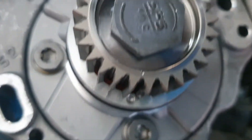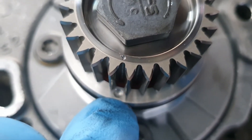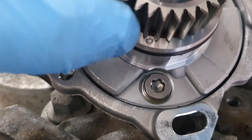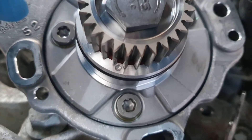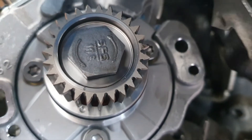What we have here is a brand new fuel pump. You can see we've got two markings — one here and then we've got this other one just up on top. They need to be aligned perfectly. When they're aligned like this and the cam timing on the sprocket is aligned correctly, you know that this is then in time properly.